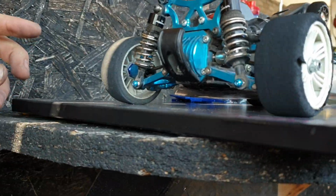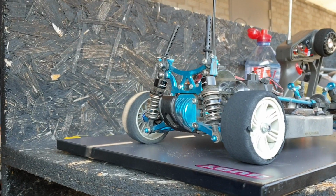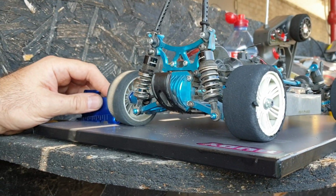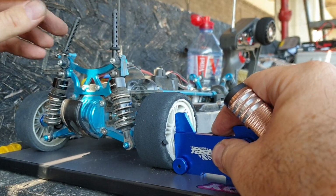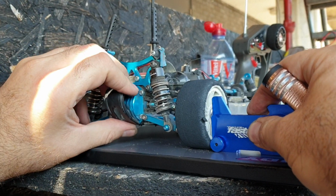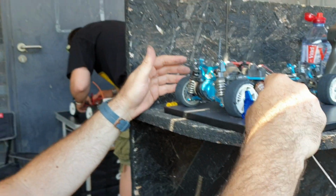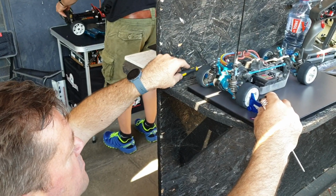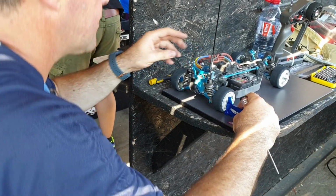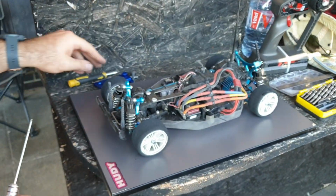So now they're fine. They're touching equally. The camber. Let's do it at 0, 0 at the rear, just to start with. Because I want you to be able to take the car out and feel a subtle difference. And then you don't do major modifications at once. You should only do 1 or 2 things at most, then test it and then come back in. Because if you do more than 1 or 2 adjustments, how do you know what the improvement is? Of course. So that's why you always just do 1 or 2, at least 1 if you can. I know it's more track time and more fiddly, but at least you'll be able to get a better accuracy of what you've just done to achieve the result.